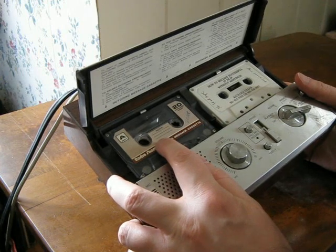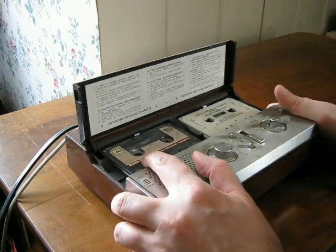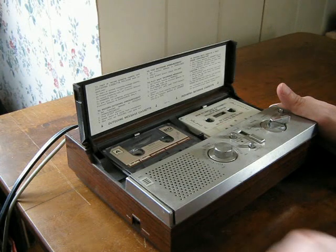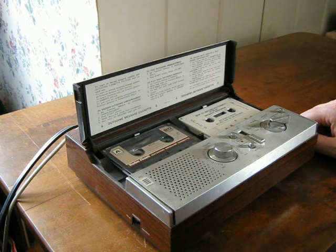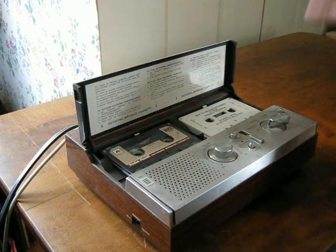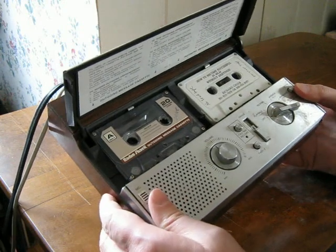This is the outgoing message — it's a 20-second tape that's looped. It has a little piece of metal on the tape, so when this starts it'll rotate, go through 20 seconds, and then the metal triggers the player to stop playing it. Then when the next message comes in it'll start playing again, and because it's on a loop it never has to rewind. This is just a standard tape for messages.